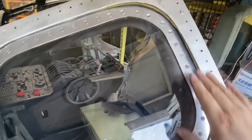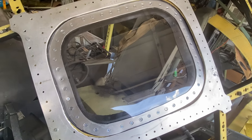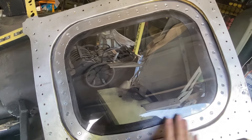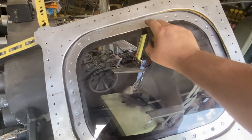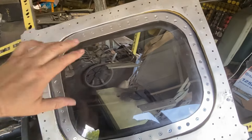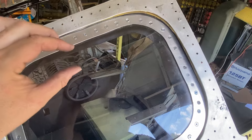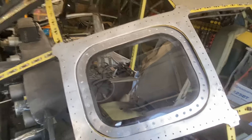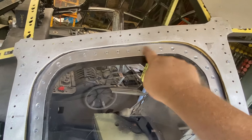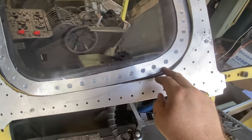Now mind you, as I've stated several times, this is not the final plate. I made this very early on, just something I kind of popped out without measuring. The real one is going to be traced off of this. This is not finished — this is just something I wanted to experiment with, to see what the process was like. I learned that I can't use my original pattern to draw these holes; I'm going to have to take this off, take a piece of paper and rub it, and use that as my pattern, because as versatile as these nuts are, they still don't allow enough movement given the thickness of the rubber, the location of the speed nut, and the angle of the sheet metal screw.